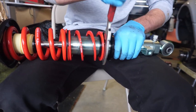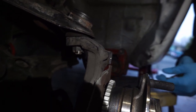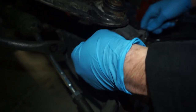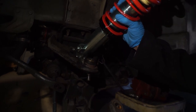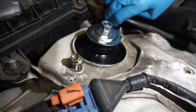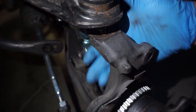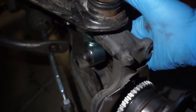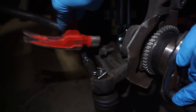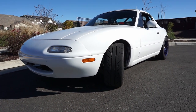So we're getting it all prepped after we get the old one out — pretty straightforward. But then we had to remove the nut from the upper ball joint in order to move that upright down as far as we could. With it down and out of the way, we're ready to get the new coilover in — plenty of room now. Same as the rear, you start those top nuts just to get it lined up, then put that ball joint back through the top of the upright and get it into place. Now we're tapping our bolts in for the coilover. Finally, brakes back on and it looks beautiful.